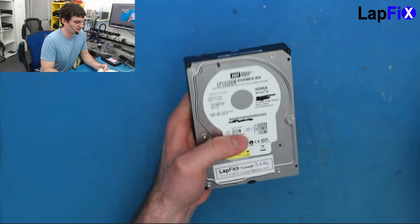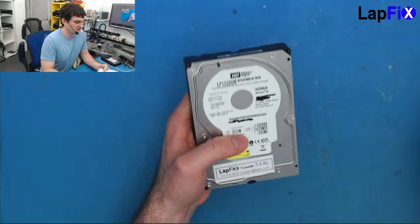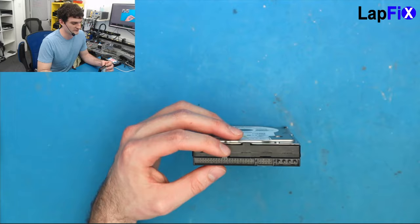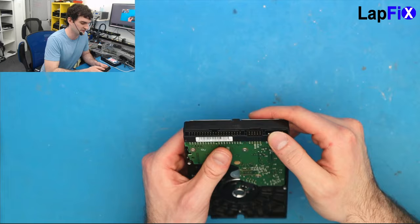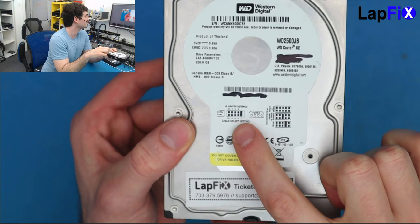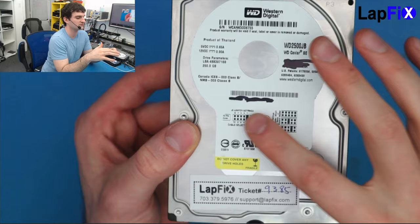The main difference with this type of hard drive versus the older ones you probably saw back in the day would be the connection. It has a Molex for the power and the rest of the pins are for data. They also come with jumpers, and on the hard drive they usually say certain things about jumpers — like master, slave. They tell you the correct cable setting that goes on the drive.